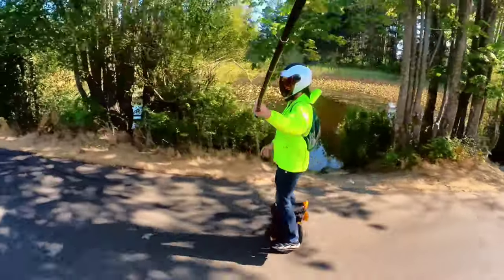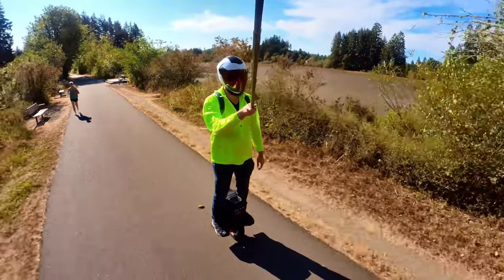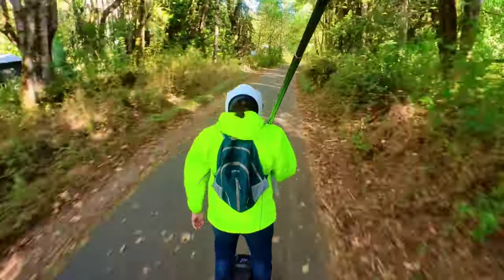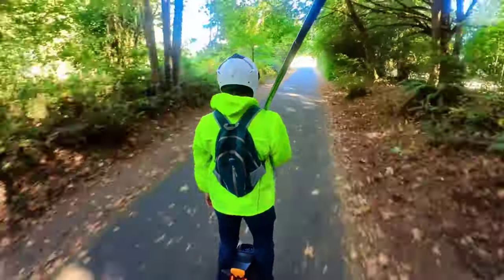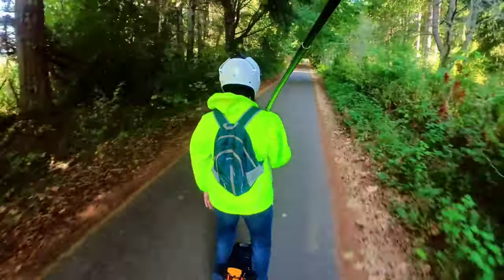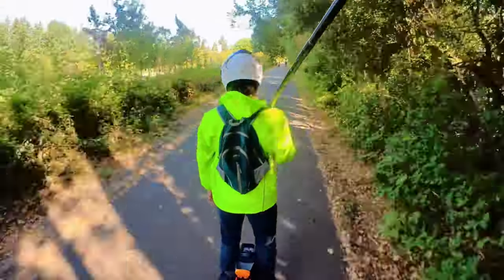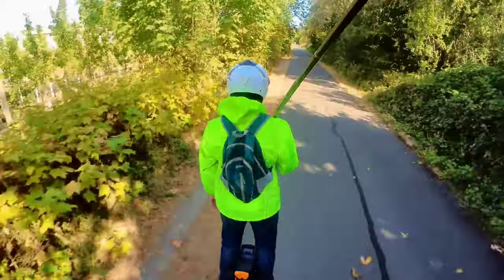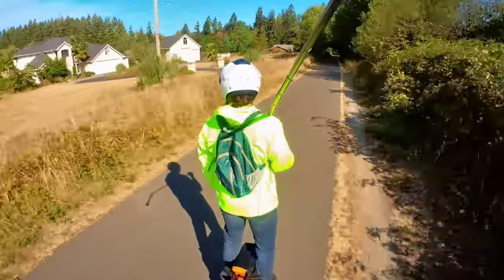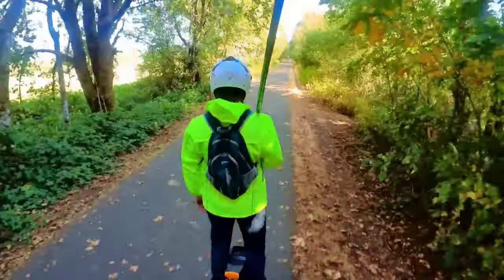I am still very, very pleased with this wheel. I do very much like riding it. The tire itself has performed very well on and off road. However, I'm not used to a street tire or a street-style tire. Filling this thing up to 40 PSI, it definitely became a little less stable. It is a very, very rounded profile, which makes it very nimble, very agile, very quick to maneuver. However, at the higher PSIs, in some of my videos you guys will see me swaying back and forth — it was very difficult to do that on this tire. It took me probably two to three miles to get used to that pressure. Others may be more used to it, but I just don't really prefer a tire like this. For this wheel though, I find it is a perfect tire.